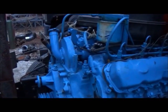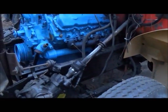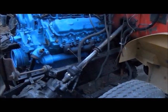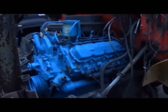Still got to put the alternator and everything on. I got unlucky on the transmission — this is one of the Allisons without the PTO gear in it; it's missing. It came out of a bus, so I'm going to have to either change transmissions, put a gear in it, or run a hydraulic pump on the motor.